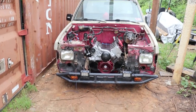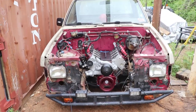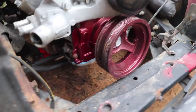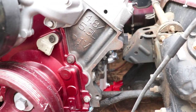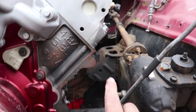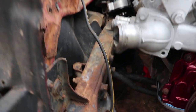Let's not get overly excited — it's just sitting in there, basically sitting on that crossmember we notched out. That's about as low as it's gonna go; it'll actually probably come up about a quarter of an inch to clear that bottom belt. Now it's sitting on that crossmember but that's pretty close to where it's gonna go. I'm going to go back in and cut these mounts off the factory Nissan mount locations — cut those off the frame on this side here.